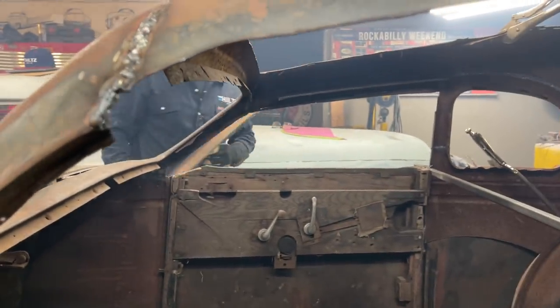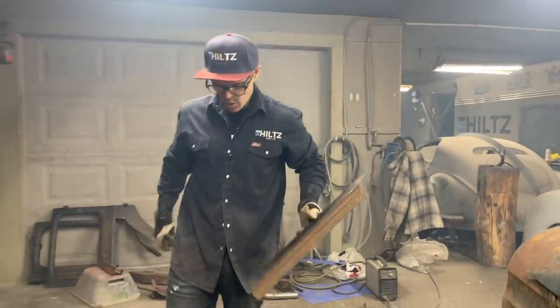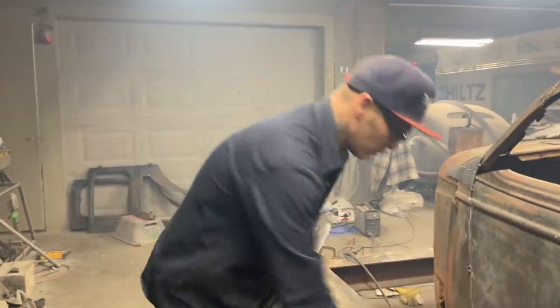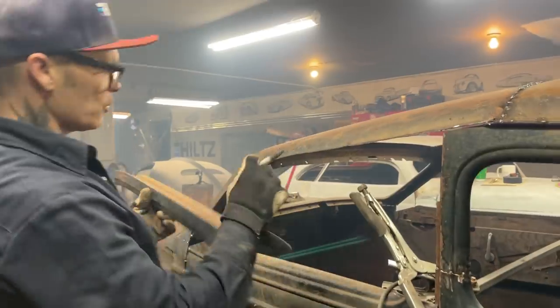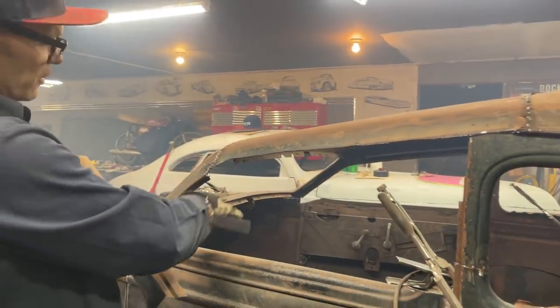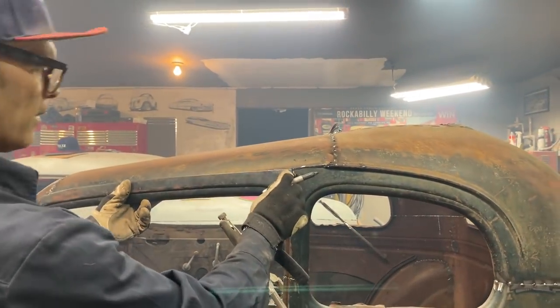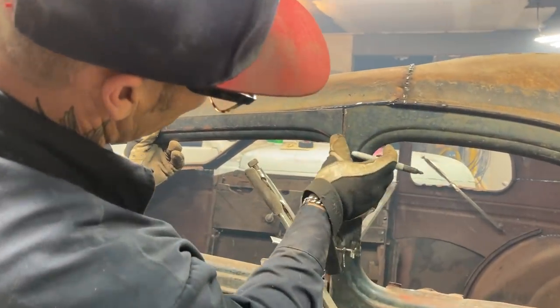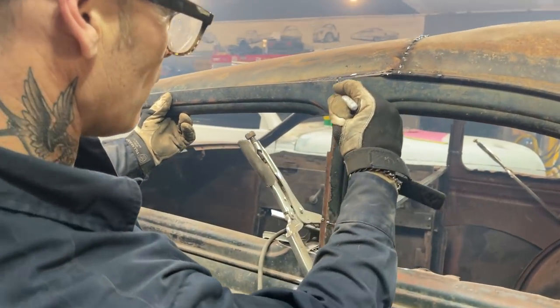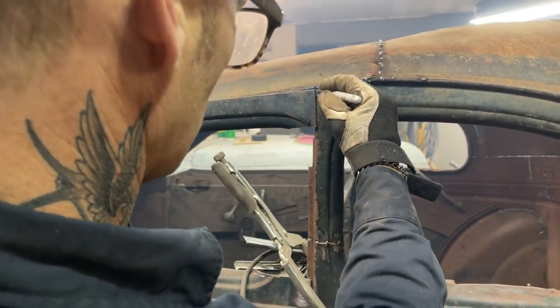The end went right on the point, right on that. So I'm gonna have to... It's gonna be close. I might cut too much. I'm not sure. So you can see, as I'm taking this up the same distance in the front, but I'm gaining 2 inches in the back. So, to me to get that in there, see that line there? I'm going to go straight with that one. I want this point right here, but I'm going to plumb it up with this line.